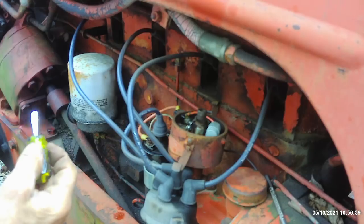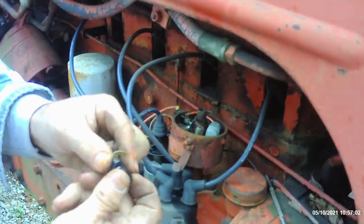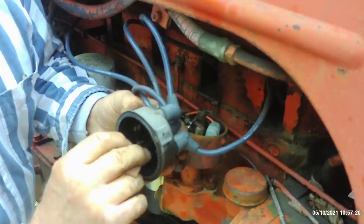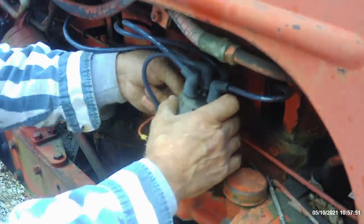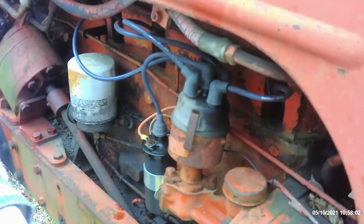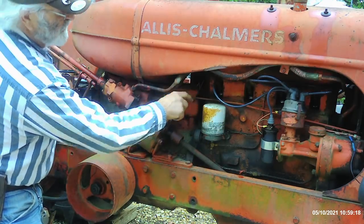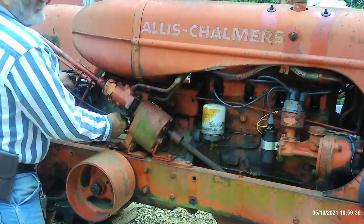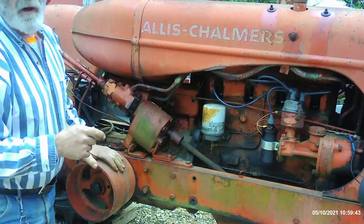Double-check to make sure there's still spark there when I turn the key on. Yep, we've got good strong spark. Just clean the tip of the rotor up just a little bit. Those aren't too bad in there, but there's a little bit of oxidation. Well, we should have spark now, so if it doesn't fire up, next step is going to be fuel — we'll probably be pulling the carburetor. Let's step back and take a look. I'm going with a half choke setting. Turn the power on — we know we've got hot to and through the distributor. Better put my battery on charger — sounds like it's kind of winding down a little bit.